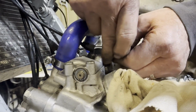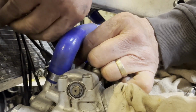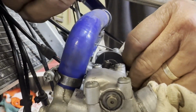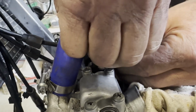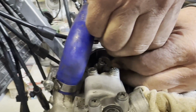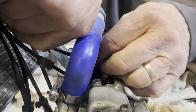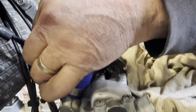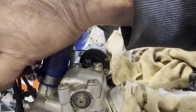Once they're adjusted, do they often come out? No, they tend to be pretty right until we pull it apart each time. You obviously pull the barrels off, which is reasonably regular. We reset it up again, and so you would check the carbies, make sure the slides go up, and make sure the power valve's opening all the way. Yeah. So that cable will drop in there now.